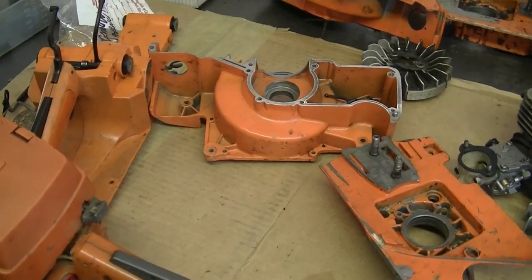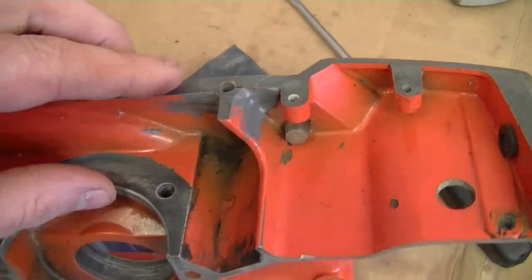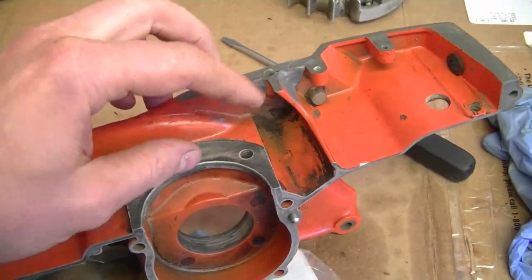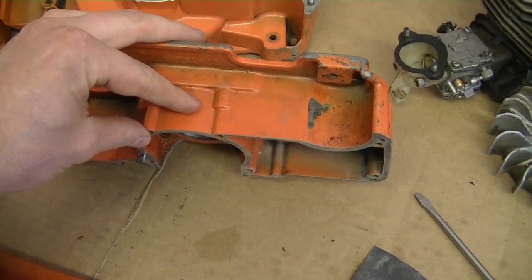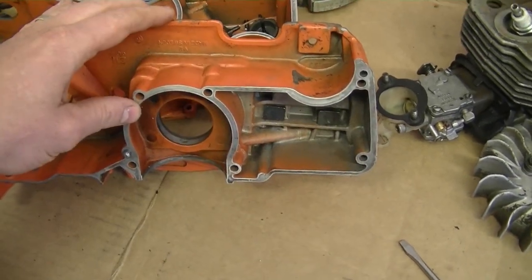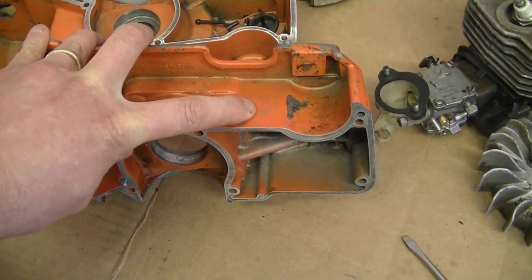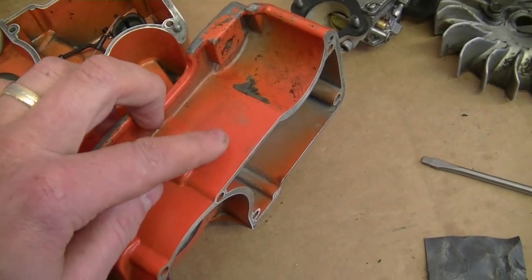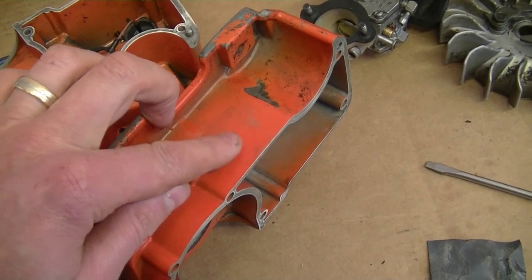First question: a YouTuber is asking how to repair a small crack on the crankcase of a chainsaw where it could be leaking a bit of oil. What I use is JB Weld or epoxy glue. For example, there was a small crack here in the crankcase of a 288 Husqvarna chainsaw and I just put JB Weld there. I've even seen guys repair cracks right in the crankcase or in the oil tank. You have to make sure the prep work is done really well — sand the area with some emery paper and clean it up really good, making sure there's no oil or grease.